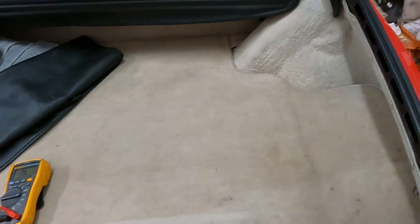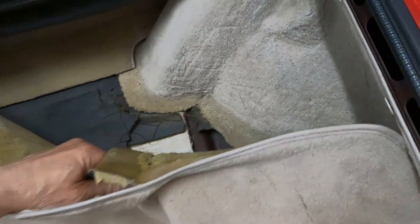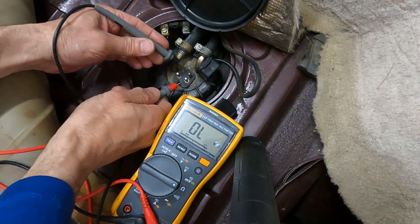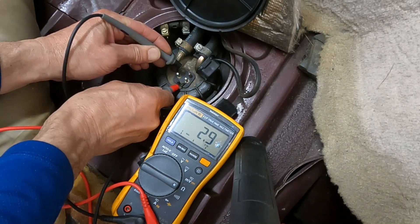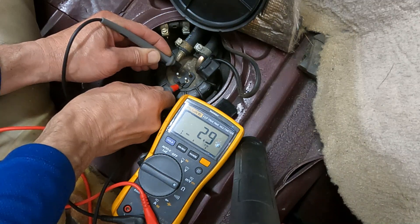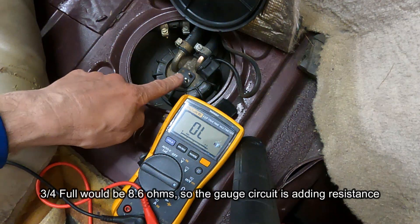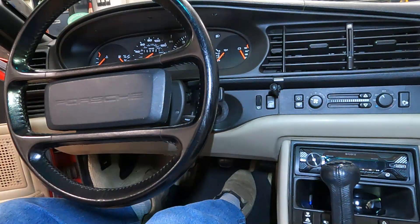The first thing we're going to do is check the sending unit. I had checked the resistance on it when I had it out of the car when I was doing some other work on the fuel lines, and it seemed like it was responding as I would expect. With an ohm meter, if you check these two pins on the right — there's a chart on Clark's Garage that'll give you the resistance readings. Right there I'm seeing 2.9 ohms, which is pretty close. I think it says 2.8 ohms for a full tank, so it's right there. And obviously the gauge on the dash was not reading anywhere near close to full, so I think that tells me the sending unit is okay.